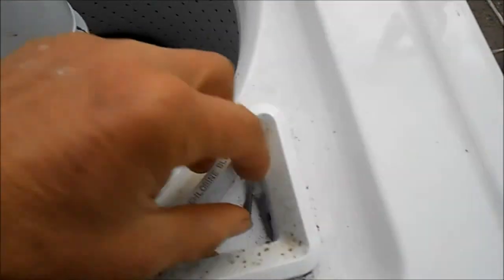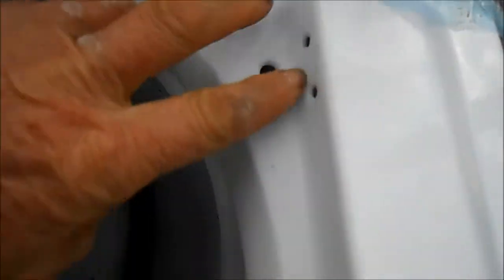There's two Phillips screws that hold it in place right here. And if you look down here, you might be able to see that the lid switch is actually coming apart. It's like a clamshell design and it's coming apart. And so we can fix this basically. And so basically you need to get some glue and a little bit of wire, maybe a vegetable wire tie, and I'll show you how to do that in 1 second.